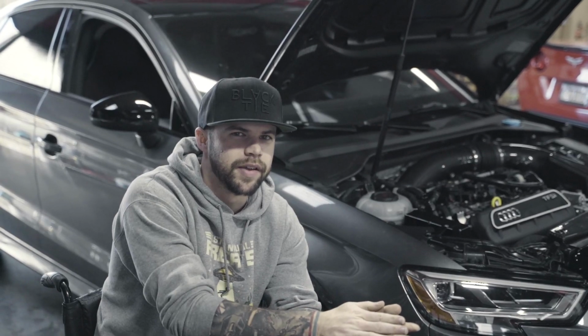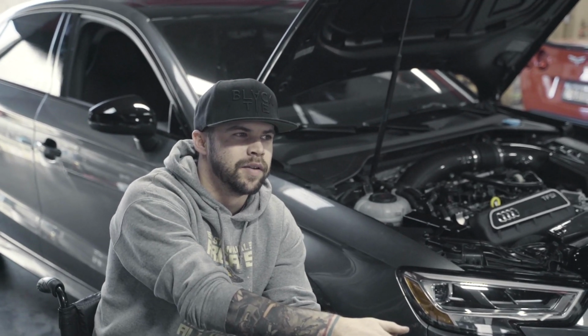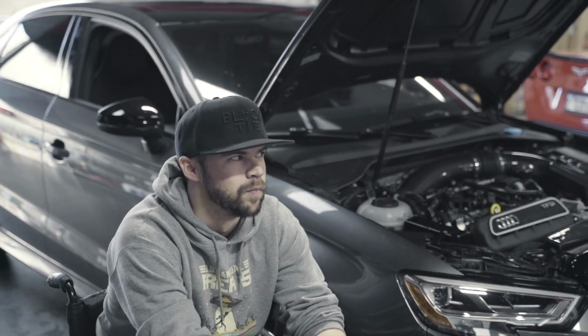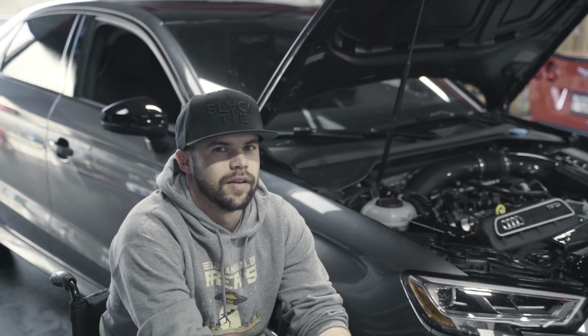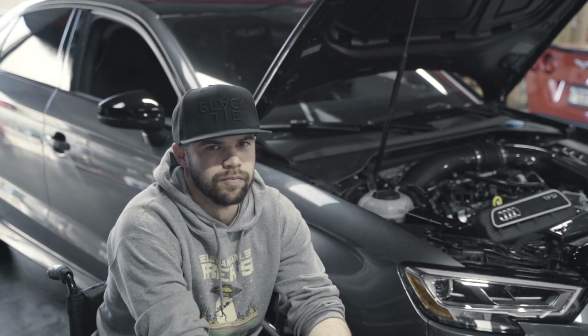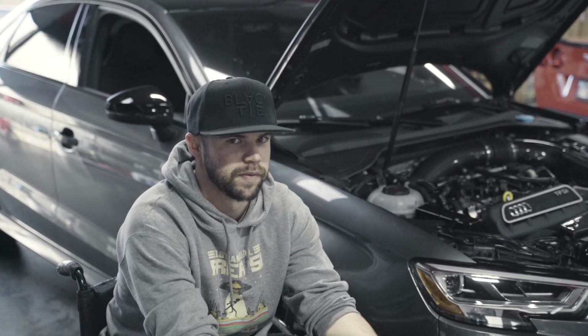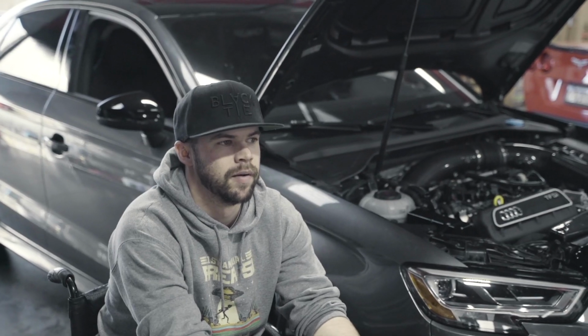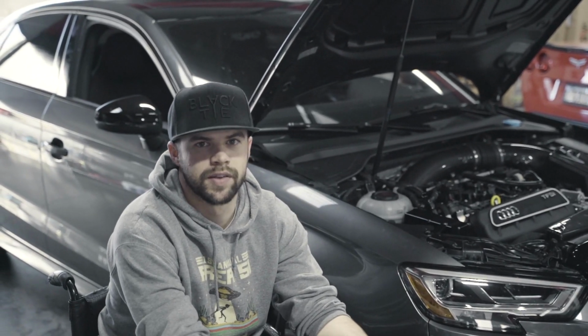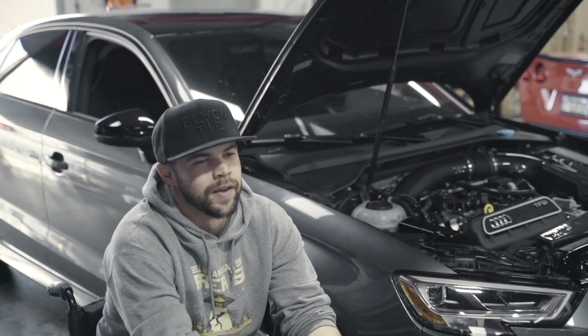So, we fixed the vacuum leaks, and me and Reese went and did a couple pulls down the street. And because we just flashed the maps and also relearn the cams, you have to drive the car around. The more you drive it, the more it adjusts and relearns itself. So we were just relearning it. We weren't doing anything illegal.